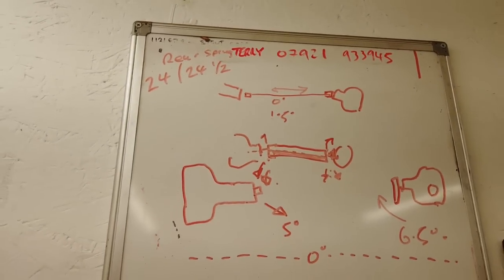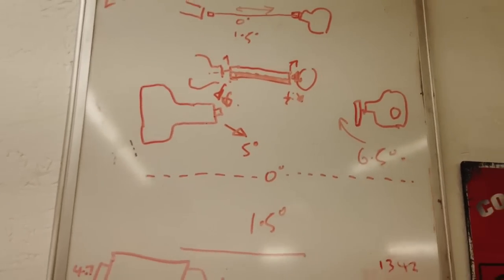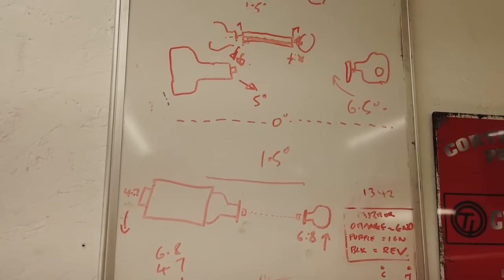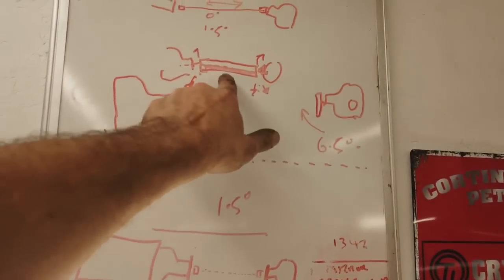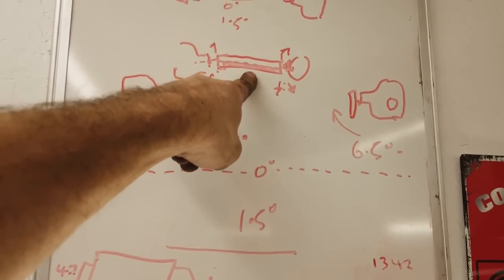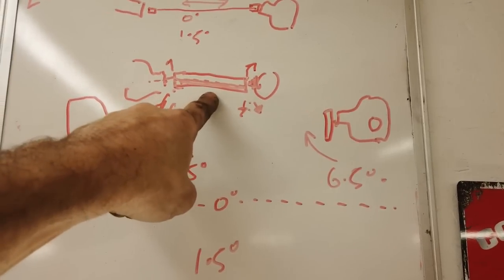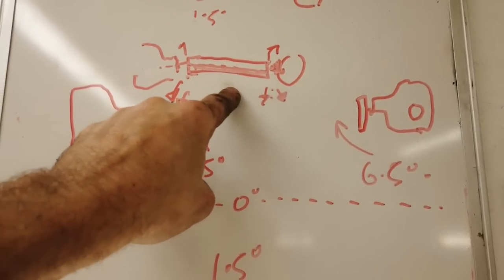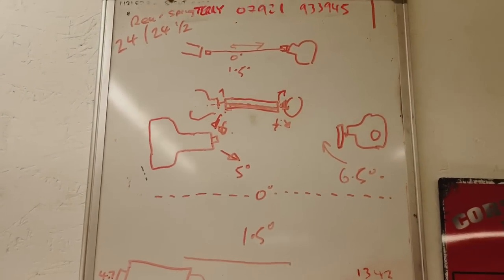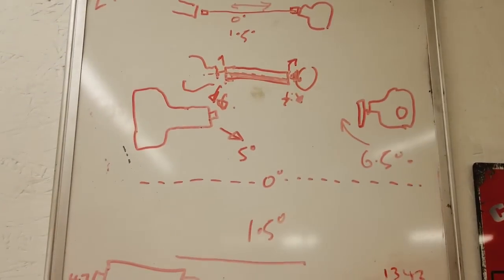If that's not made any sense, I do apologize, you can get more detailed explanations on the internet, but we've got to set this car up so that the prop shaft has between 0.5 and 2 degrees pitch on it when the car is sat level and loaded. So we're hoping by the end of the day, when we lock it all together and I put the protractor onto the prop itself, it will be either 0.5 or maximum 2. I'd like it to be 1, to be fair, 1 degree. So we're going to head for that now.